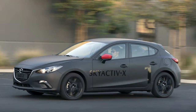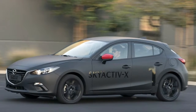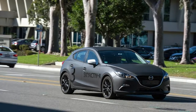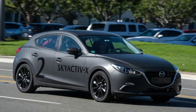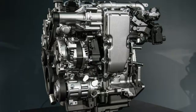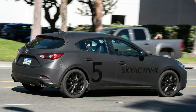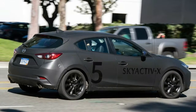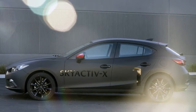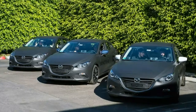That takes a few essential components to get just right. One is a massive amount of computer processing power and pressure sensors in the individual cylinders, because ambient conditions change how and when these things happen. Skyactiv-X uses a clutched supercharger to pump in additional air when needed to nail the mixture precisely, and high-pressure injectors to disperse the low fuel ratios properly in the chamber. Since it also operates like a conventional gasoline engine sometimes, it uses valve timing to lower the very high compression ratio so it doesn't reach compression ignition in that mode.